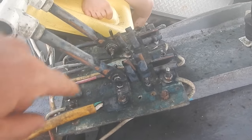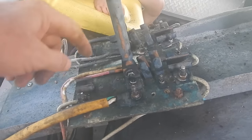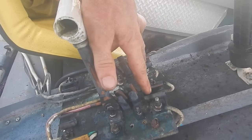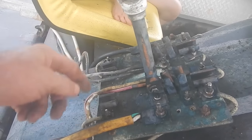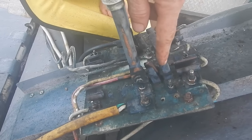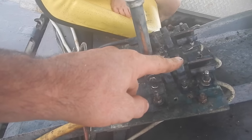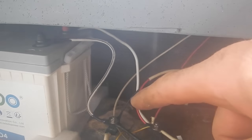I better not go reverse right now - if I do reverse right now it's going to reverse at full power. So I need to disconnect one of those wires. Because this is connected reversed to these, that's so it runs in reverse. But I need to have this connected in reverse through the coil because I don't want it to jump into full power reverse - I want it to jump into medium speed. Oh, there's so much less mess down here now.